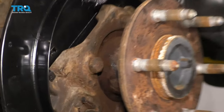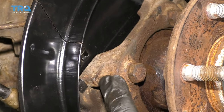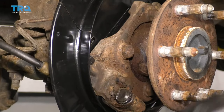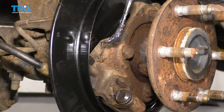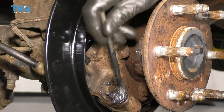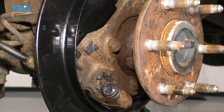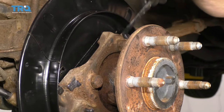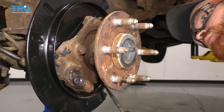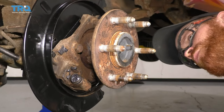You're going to need a little bit more of that caliper grease and you're going to put it on the contact points of this bracket where the emergency brake shoe is going to ride. The reason for that is vibration dampening and noise reduction. So we'll come right down here because we know it's going to ride right along the outside there. You can clearly see exactly where the emergency brake shoe was riding before.